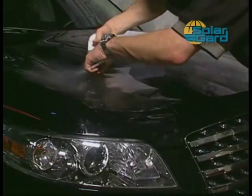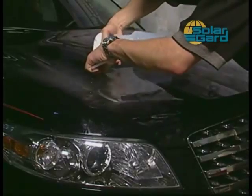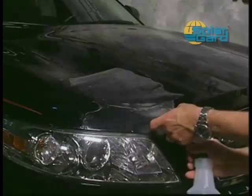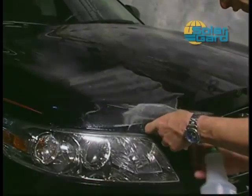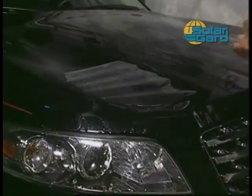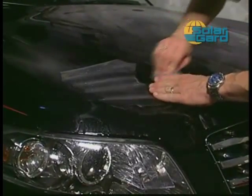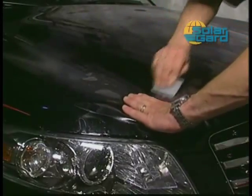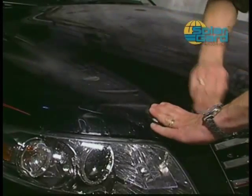Begin by spraying the alcohol solution into the bridged area from the top and bottom of the pattern. Do not be afraid to use a lot of solution to ensure the product will tack down. Place your fingers or hand in the bridge area to help the film conform to the surface. Now, using the squeegee, lock down the product as you push it into place.